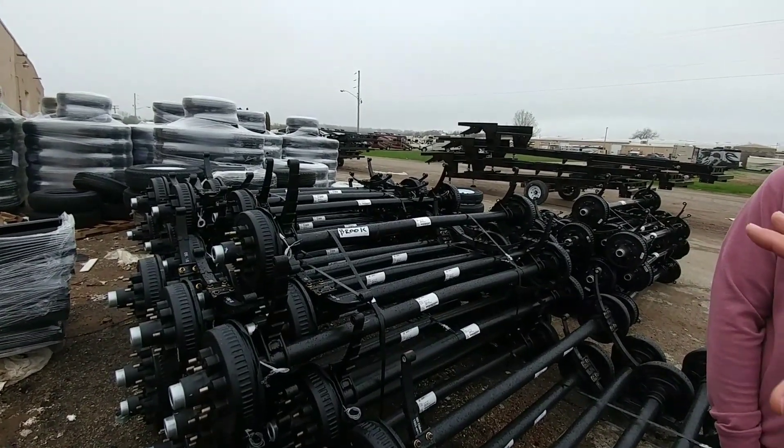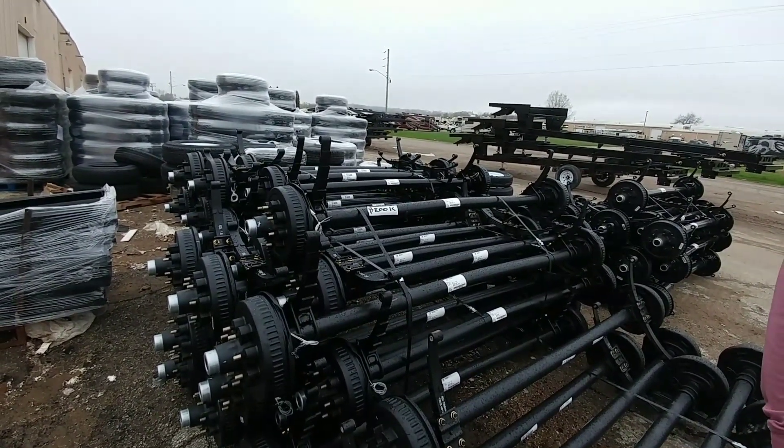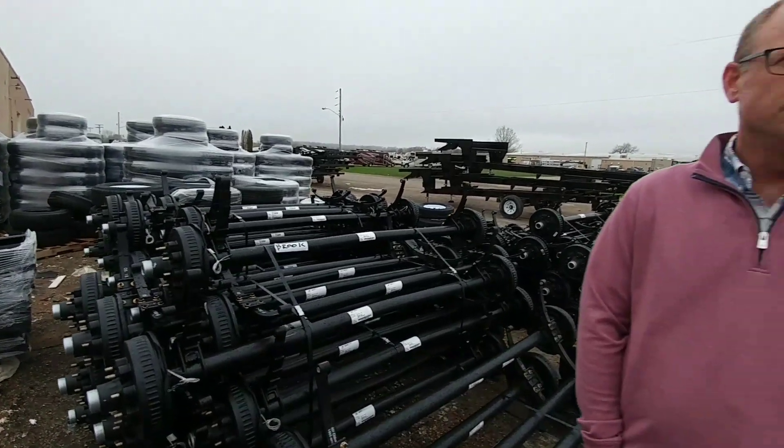People don't ride in fifth wheels — it's just not safe — so those factors are all accounted for. I wanted to answer the question I get asked all the time: why are axle capacities so close to gross vehicle weight? It's because the axles are never designed to bear the entire load of the fifth wheel. The Chaparral 360 IBL is a great example — twin 7,000-pound axles and a GVWR of 14,000 pounds. The heaviest Brookstone is going to be under 16,000 pounds, so you're well within the specs of what a 7,000-pound set of axles can do.